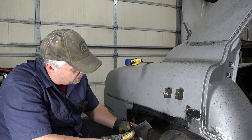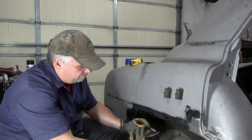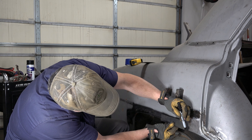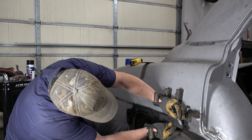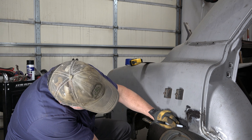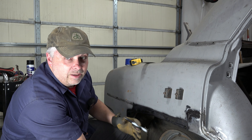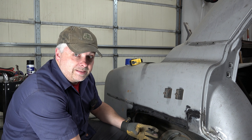I've got to come up more, which I expected. But again, it's sort of a rough angle, so it's not going to be perfect, but it's going to be better than what's there. So I've got our line — I'm just trying to mark to where I start. I can see it kind of comes up, so I'm going to mark some of this nice clean line and cut down. This is just a rough, very rough patch. It'll look good when it's all done — it's going to have a little filler in it. That's going to be just fine.